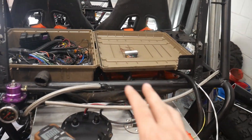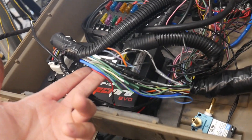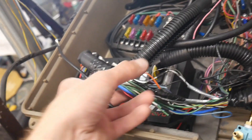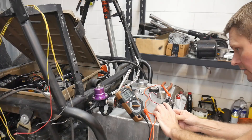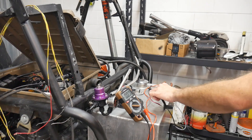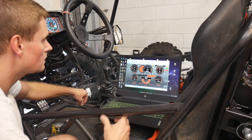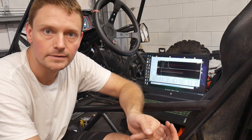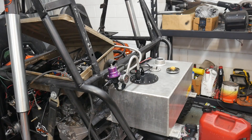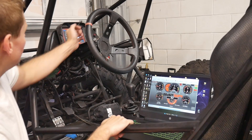Unfortunately we are in a no-start, no-fire position at this point. I've been trying to diagnose these setups when you're not getting an RPM signal - typically that's related to a crank sensor. I do hope it is a failed sensor. I've already gone digging through the wiring harness just to verify it was accurately connected and it is correctly connected to the ECU. Day two - just like I was testing this one for voltage, I'm going to test this one for voltage. See that signal drop off - nine volts. So it was a faulty sensor.